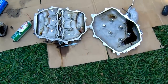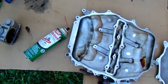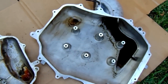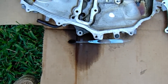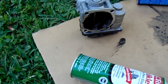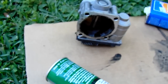I had quite a bit of oil in the intake manifold. The book says to use lacquer thinner, so I put a bunch in and let it soak — it really freed up a bunch of oil and debris. It was pretty ugly and took me quite a few times to clean that out. I used carb cleaner and lacquer thinner to get all the oil out. The throttle body was just pasty with oil — that took quite a bit of cleaning as well. Just takes some patience.